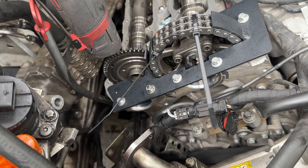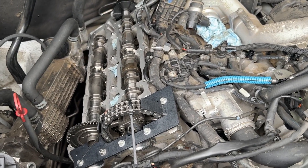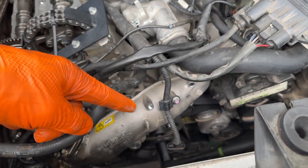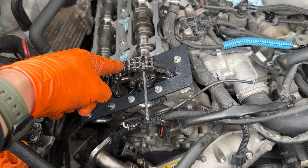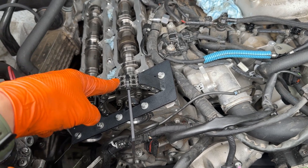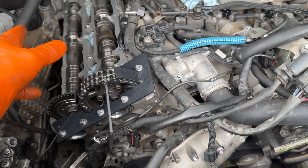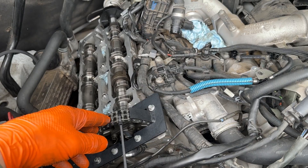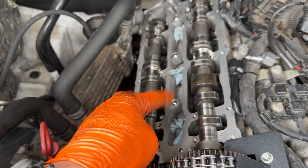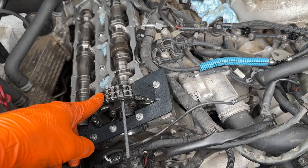One more important thing — we're going to double-check the timing again. Rotate the crankshaft, put it in zero position, and check the marks. This is very important. I had a case once where the chain ran out of timing — I don't know how it happened, but I assembled everything back, put the engine in the Sprinter van, and couldn't start it because it was out of timing. It then broke all the rocker arms, so I had to disassemble everything again. Be attentive, be smart, and everything will be good. Stay tuned and subscribe for more.